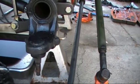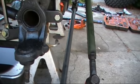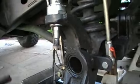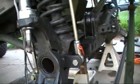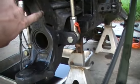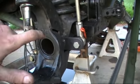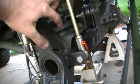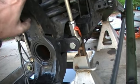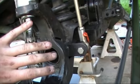Like I said, this axle had 0 miles on it before I trussed it, and 0 miles before I reinforced the C's. Just to cover some aspects, because I know I'll get questions: the C's are gusseted with Poly Performance outer C's, and inside the upper C is a Rock Slide Engineering inner C gusset. Inside here is a 1-inch wide steel plate that gussets the entire backside of the C like a spine. Then this gusset is over that. So trust me, my stuff's not going to move.